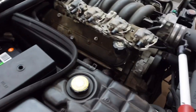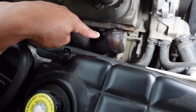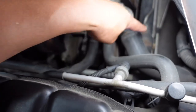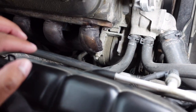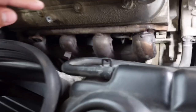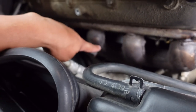If you own a C5 or you ever own one, you know that the compressor is in a terrible spot. It's down on the passenger side at the bottom. The header is right above it, the water pump is right above it, and then there's a steering rack right in front of it. So it's like in this little cage and it's really a pain in the ass to get to. Normally people will take the water pump off and the steering rack to get to it, but I'm in the process of doing long tube headers on the car and it looks like if I remove the header I might have enough room to sneak it out the back and down to the bottom. I might have to remove the starter.